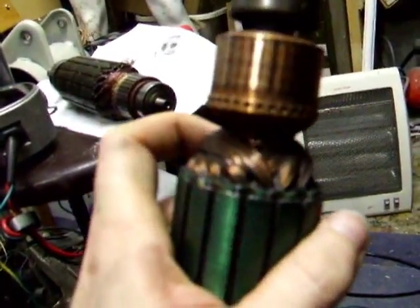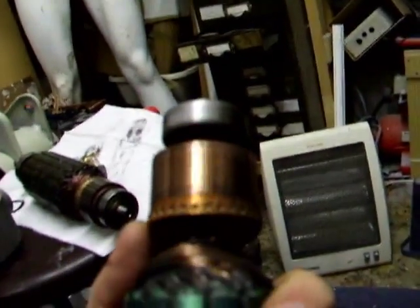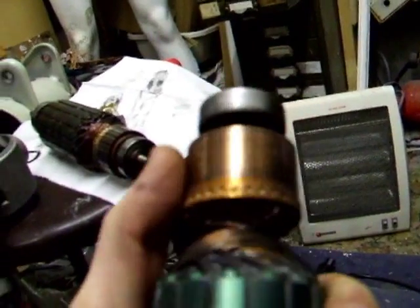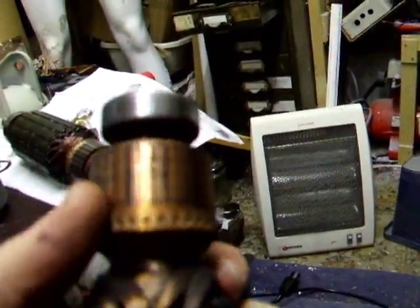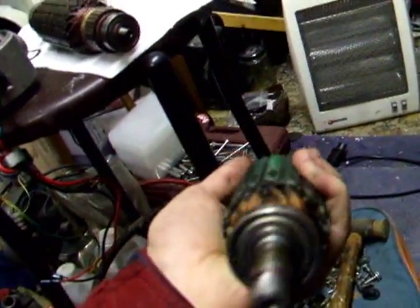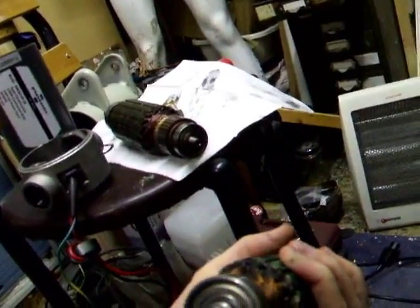The coating on all the windings is in beautiful condition — it's solid, it's intact. The Green Master one is ragged and messy. This original motor was supposedly in the treadmill for three years before it stopped working and had to be replaced. The commutator is in very bad condition — it's scored, not deeply, but you can see lines along the edges of each bar, and a few vertical scratches as well. But there's almost no debris, almost no dust at all. It seems to be entirely down to the commutator. This motor core is just in beautiful condition — that is a beautiful, beautiful bit of engineering.